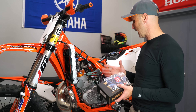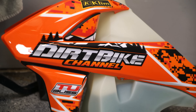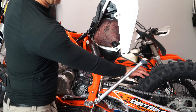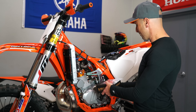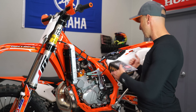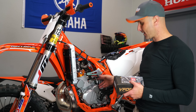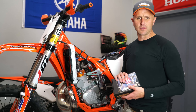I don't think this is going to be too difficult to install, but one thing that is definitely going to help — I took off my tank, already done that. I'm going to basically swing my subframe out of the way. I'm going to loosen my carburetor and loosen this boot back here and get the subframe swung up out of my way so I can get the carburetor off and get at this reed cage. So let's take a look at how this is done.